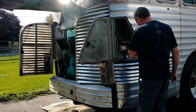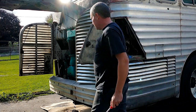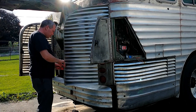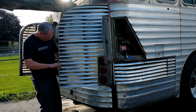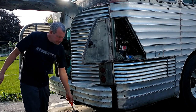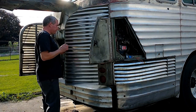Maybe let's start at the bus and see what voltage we have. Maybe it's just a bad gauge at the front. I wondered about that. Now this starter, once in a while, won't start, and all you've got to do is bump the flywheel ever so slightly, and then it'll fire right back up again.